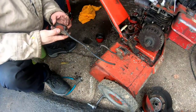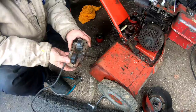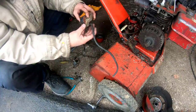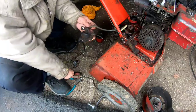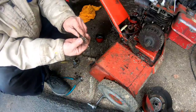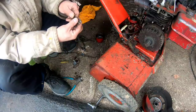So I think I found a good magneto. This one I pulled off of a lawn tractor engine. One of the three that I got yesterday, remember? But this is made for a lawn tractor with a bigger, rounder flywheel, so that this entire thing is not exactly touching the flywheel. So this one here fits, okay? I'm going to have to test the circuit to see whether or not it's a good magneto, but this is missing the end to it. So I just removed the end from the points one, because I'm not going to use this anymore, and I'm going to put it on this one. So it just has to make a ground contact there. So I'm going to connect this, and then I'm going to test this magneto to see if it's good. I probably should have tested it first before I did this, but it's okay. It's all fun. Not really. Yes, it is. No, it isn't.